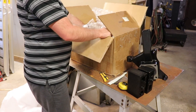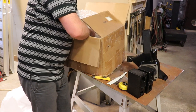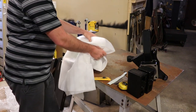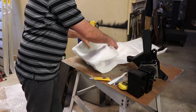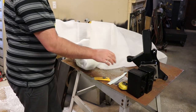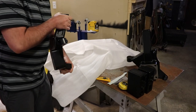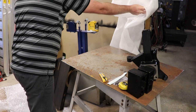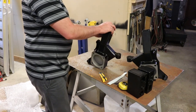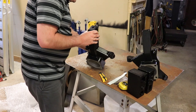I'll be getting lots of before and after measurements on the vehicle as I do this job. The first thing I'm going to do is put on the rear spacer blocks, as I think that'll make it easier to lift up the van on the front end afterward. I can knock those out pretty quickly, whereas the front spindles will take a bit more effort. These blocks have nice tapered holes — you can hit them with a sledge quite a few times without worrying about caving them in.